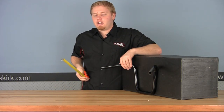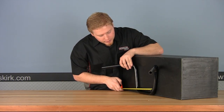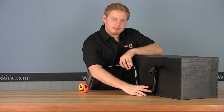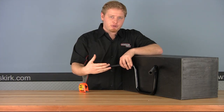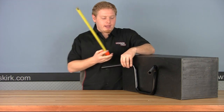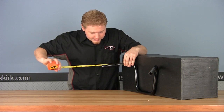The second measurement is our center width — make sure you're writing these down. From bar bend to bar bend, this one comes in at 8 and 1/4 inches. Keep in mind you want to be as exact as possible, because if your motorcycle has a triple tree or clamp that runs 8 and 1/2 inches, this one won't quite fit due to the extra bend. So make sure you have enough play without it sticking out too far. We have our end width, our center width — now we'll move on to our pullback length, which is from the front of the bars to how far back they come. On these bars, measuring up against the wall to the center of the pipe, it comes out to right at 7 and 1/4 inches.